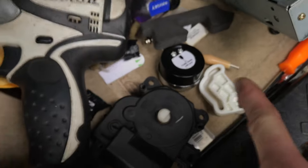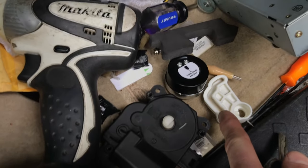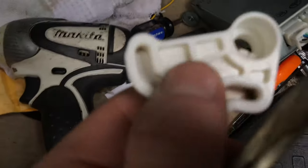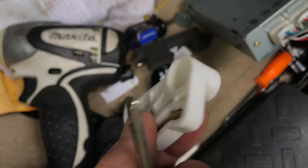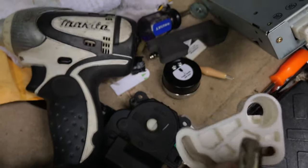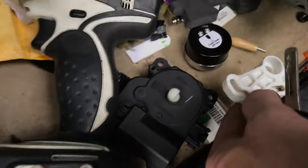After ten minutes of trying to fit the actuator on the outside of this case, I'm ready. I swapped out these clips — it's easy enough, there's just one little tab in there to remove. So if you ever replace your servo and the whole assembly didn't come with it — say you got a servo on eBay or just the internal parts — you can take this clip on and off with a small screwdriver. It's now on, and looking in there it's showing outside air.